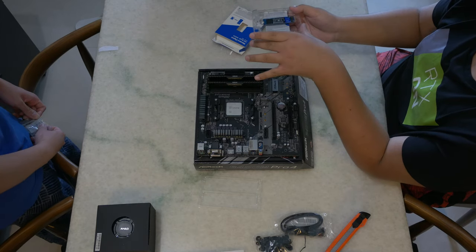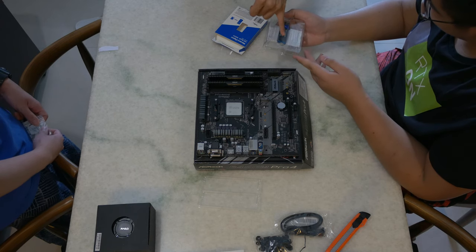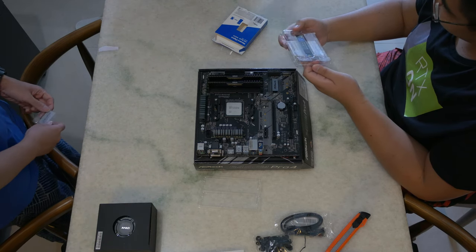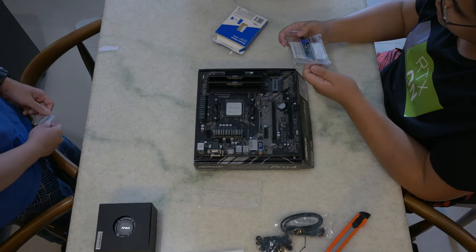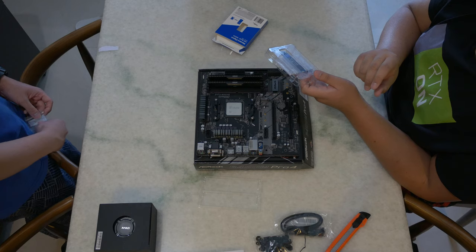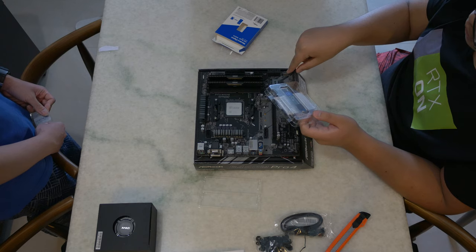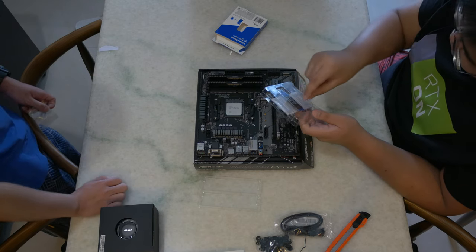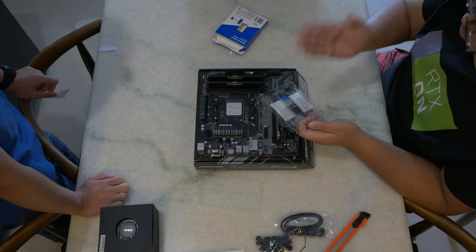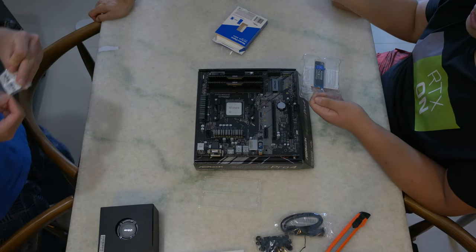This little block contains all your flash storage. As you get to a bigger drive, you'll have more modules in here, but since we have the smallest capacity, we'll only have one. Then we have the controller, which is basically like a little computer that tells the SSD where to organize all the data. Compared to SATA SSDs, the material inside is actually the same — this one just uses a different, faster standard, which tends to be more expensive. That's all there is to it — underneath, it's all NAND gates inside.